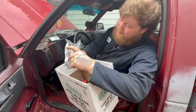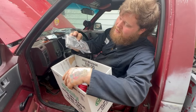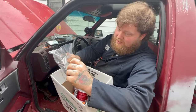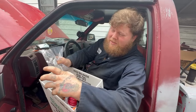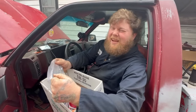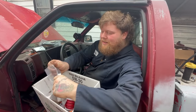And then you put these clamps that aren't big enough for my exhaust, 2.5 or something. But you run these clamps around this plate and it straps it to your exhaust. It's basically a no weld system for the Holley sniper kits. Basically for the average DIY guy that doesn't own a welder, maybe, that's just trying to upgrade his hot rod.